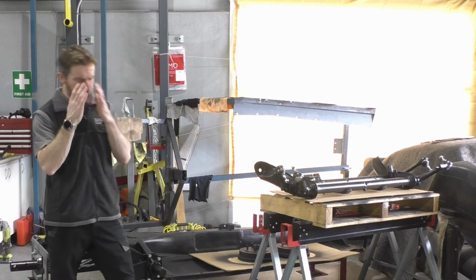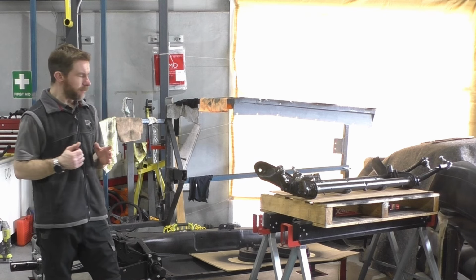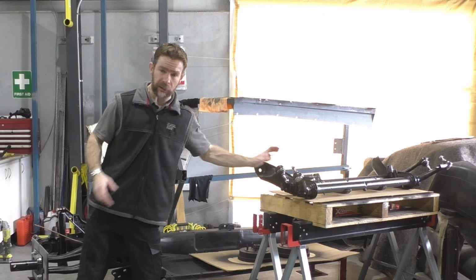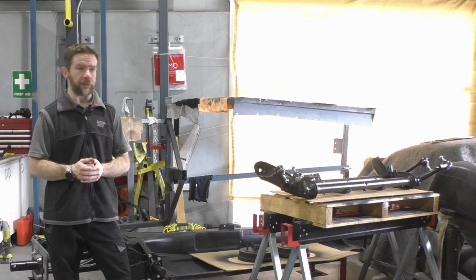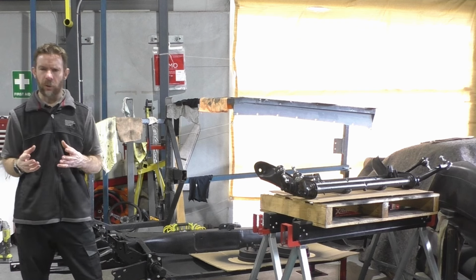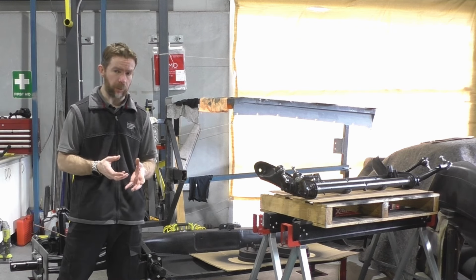Much to my absolute bewilderment, I last week could not get them in, two weeks ago, couldn't get them in, and I ended up taking the entire arm sleeve to a shop. They pressed them in after forgetting about them for a week, so I eventually got them. I got them literally yesterday. And when I got them back here, I thought that they'd actually installed them wrong. They're actually a directional ball joint, so they can really only be pressed in one way to work properly.